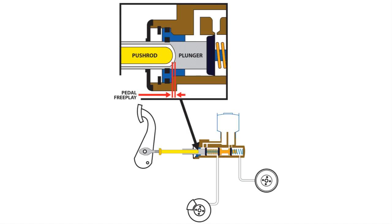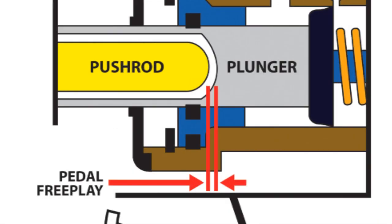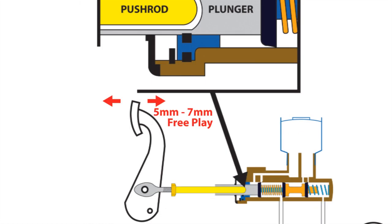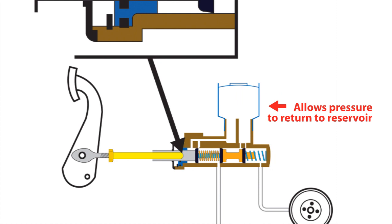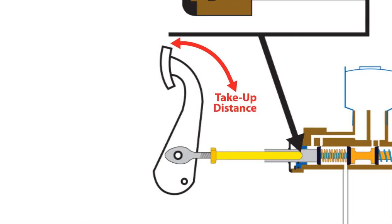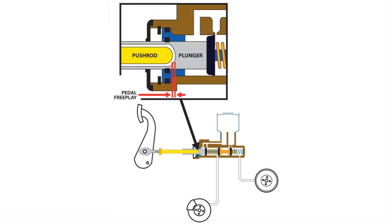With your master cylinder and all brake components installed, and all lines sealed and tight with no chance for leaks, it's time to check the master cylinder pushrod free play. Brake pedal free play is the amount of pedal movement before the pushrod touches the piston inside the master cylinder, before the piston starts to move. 5-7 mm of free play at the top of the brake pedal translates to about 1 mm of play between the end of the pushrod and the piston in the master cylinder. This distance is critical to assure that after braking, the piston returns far enough to allow the pressure built up during braking to return to the reservoir. Don't confuse this with take-up distance — the distance the pedal travels before braking action actually occurs. Excessive take-up distance can be eliminated by bleeding air out of the lines and adjusting the drum brakes at the rear wheels. If you have four-wheel discs, the calipers will self-adjust; you just need to bleed all the air out of the system.